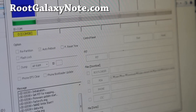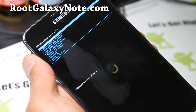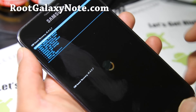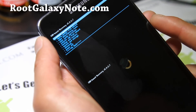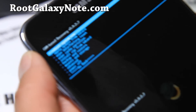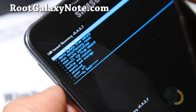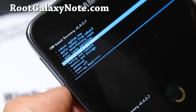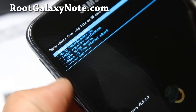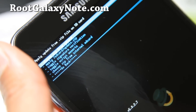It's almost done and my phone is resetting. It actually rebooted into Clockwork Mod Recovery. You can also hold down volume up, center, and the power button to get back into Clockwork Mod Recovery. Let's install the ROM — just go to Install zip from SD card, hit the power button, then choose zip from SD card or internal storage, depending on where you put those files.